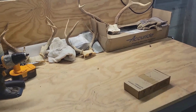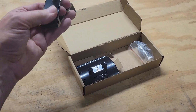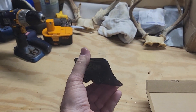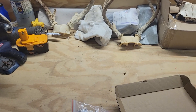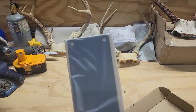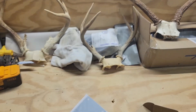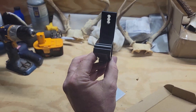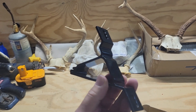Here is the awning support I bought. I'm going to mount that directly to the wall. Here's the cradle that rocks back and forth as it goes in and out. There are a bunch of screws and a big black mounting plate. I'm going to try and not use this plate — instead of mounting it to the outside wall of the RV and then mounting the cradle to the plate, I'm going to try mounting the cradle directly to the wall. It's adjustable, and if I can find the stud, that's what we'll do.